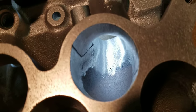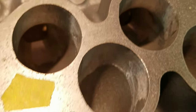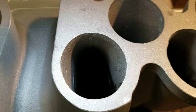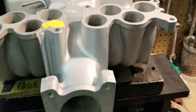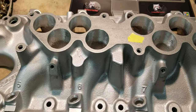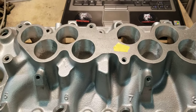This work is very familiar. Pretty much just a basic gasket match from this guy's work. You can see a lot of areas that just weren't hit, and the upper is basically stock. The upper is stock, and as much content as we have out there, we still get a lot of customers messaging us asking to port the lower only. That's because that's what they've heard for years from guys like the Popular Porter, who tell them to port the lowers because the uppers flow pretty well. That's not true.